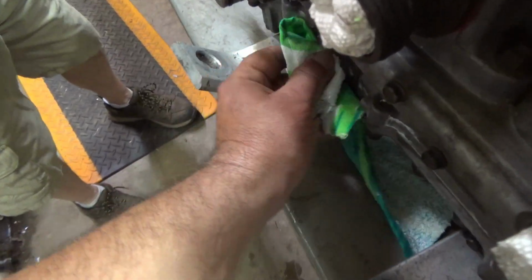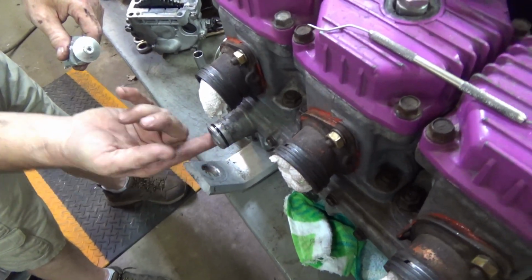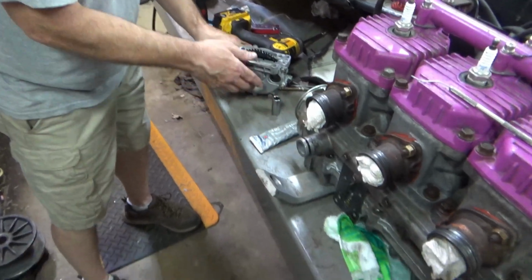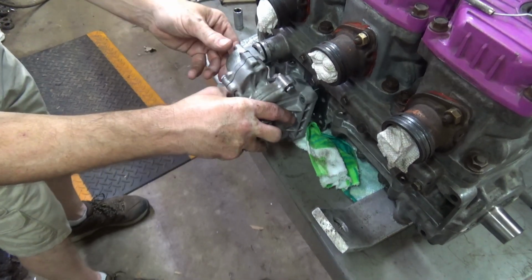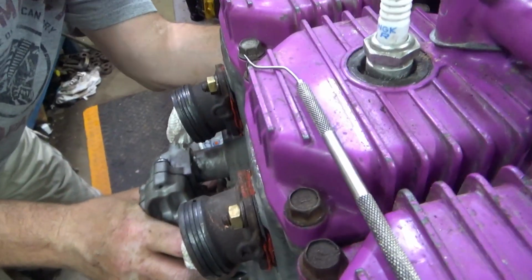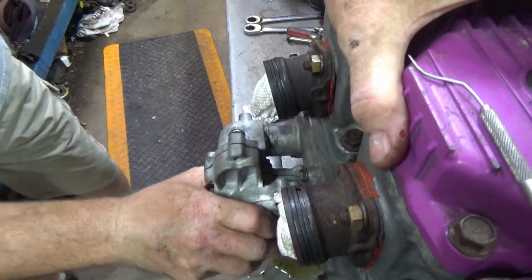Of course, all of our oil came back out, so we'll have to refill that. That's more than enough. It's just got to be wet. There we go. Hopefully we'll get this solved right now, get it on, not tear the O-ring. Yep, just like that. I'm going to get this rag out of there. Thank you. She's done dripping. How's that feel? It pushed some dielectric grease. Did it tear the O-ring? Should we pull it off and check? Yeah, pull it off. See if the O-ring's still intact.